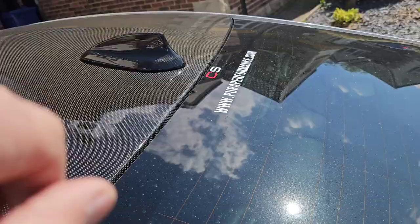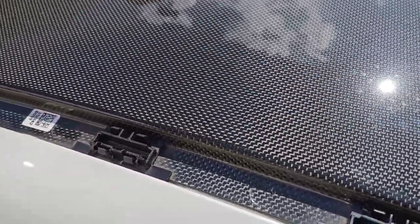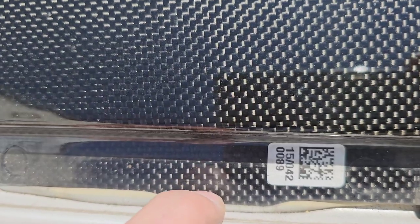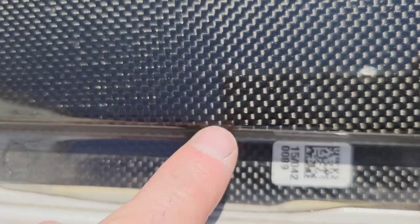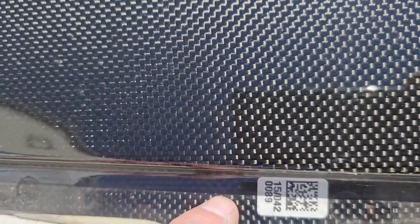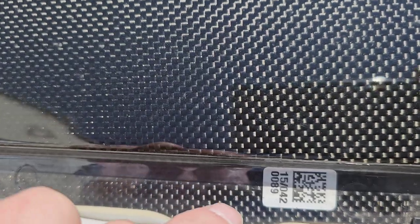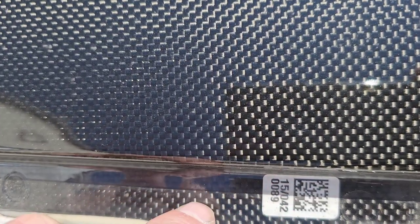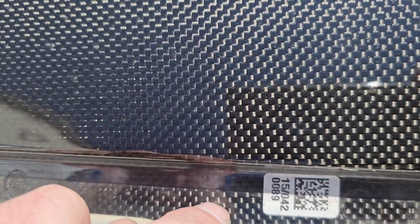What we need to do is measure the center of this mark here - where you can see it tapers in, you mark the center there, and then the center between the edge and that edge there. That will give you the location point for the mounting plate. So you drill a hole 15mm, and once you get the carbon and the adhesive out the way there's a bolt that you need to take out.